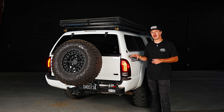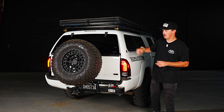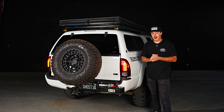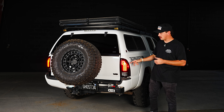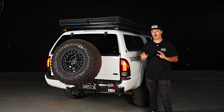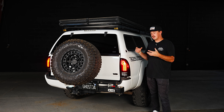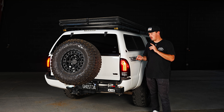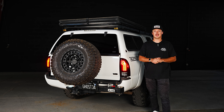If you want to pick up a set of these, go to our website tacomalifestyle.com. You can get either a set of the smoked or the red — they are available now. One important note: these will hyperflash if you're running an Alpharex headlight. So if you want to get rid of the hyperflash, add a resistor. These taillights do work with the OEM or the Morimoto headlight, so you won't have to worry about that — only with Alpharex. Subscribe to our YouTube channel if you want to see more install videos or more Toyota Tacoma content. We appreciate you guys for watching. See ya.